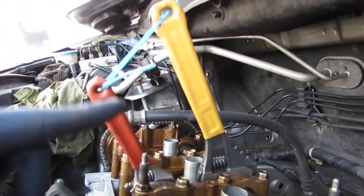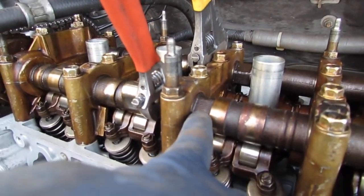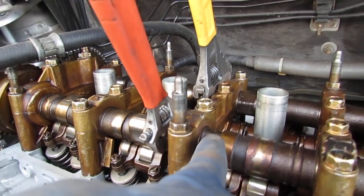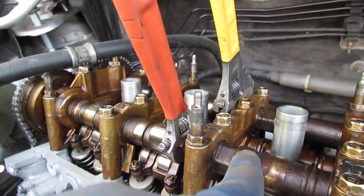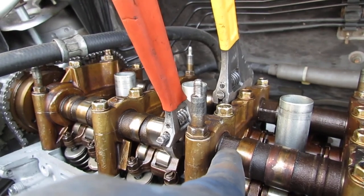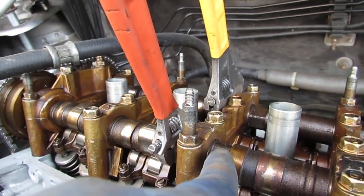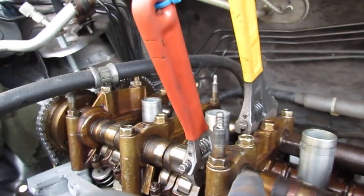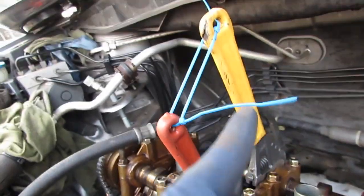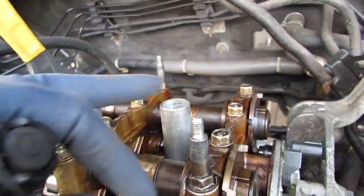Okay, let's go over to this side. This is essential. I had two 23 millimeters, because I thought that's what would fit on these shafts, but it's not. It just won't go down. I have no idea why. It's close, but no cigar. You might want to jump to 24 millimeters or SAE 15/16ths. 15/16ths would be closer than 24. But other than that, I put 23 millimeters on here to hold this together so it doesn't keep jumping around, because the pressure of the spring wants to turn these, you know?